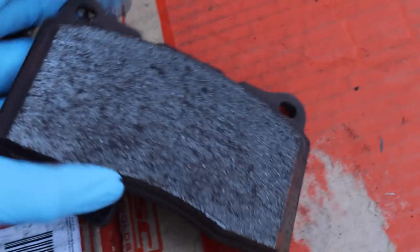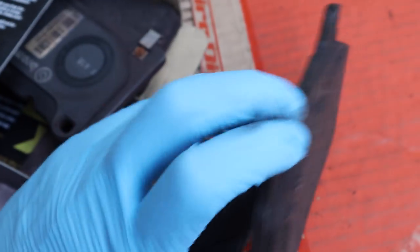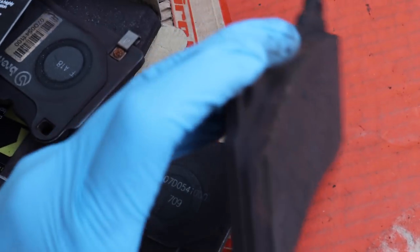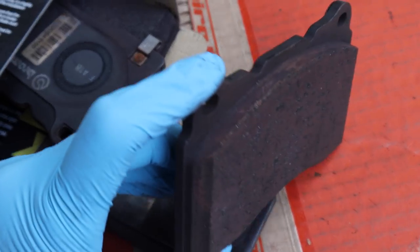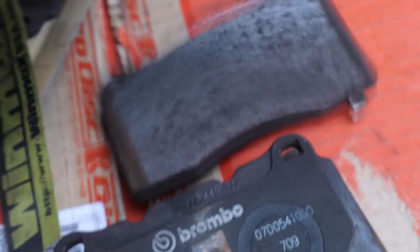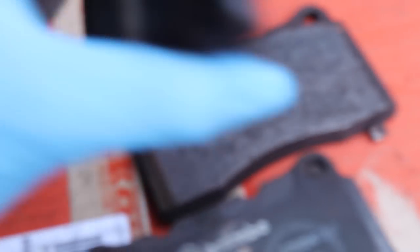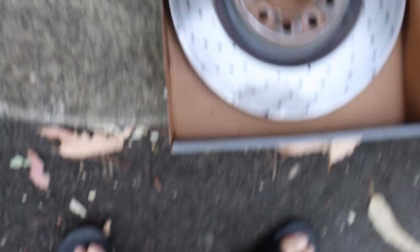Here's the front pads. There are the front pads — they look a little better. There's a little bit of life left on these. I could probably use these for street purposes for a little while longer, but I've got another track day coming up. I don't have extra time on my hands, so I just went ahead and switched over to the WinMax now. Those are still usable — I certainly wouldn't use them for another track day. But this just gives you an idea of what cars go through. I'm only going to look at one of these because it should be pretty representative of the other side. These are the stock rotors here.